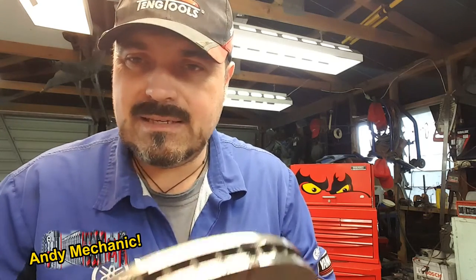And when they come in the box, they're covered in a protective sort of wax, really. It's not grease, it's a wax. And you've got to get it all off. What I use to do that is good old trusty brake cleaner and a clean rag. And you've got to clean it all off before you put the brake disc on the car, because if that wax gets into the new brake pads, they can squeak, it can act as a lubricant, they're not going to work as well. Pants. Good Yorkshire term.